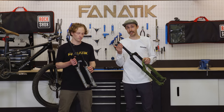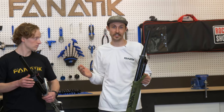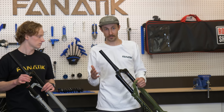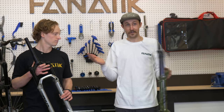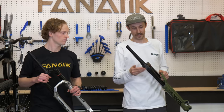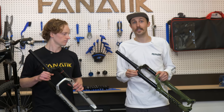This is a big deal — it makes it a lot more intuitive for riders. For example, you're running through some rollers and pumping too far into the travel, so you increase your low speed compression without messing with your high speed compression in case you front-wheel case a jump. RockShox has completely separated the high and low speed compression adjustment within this damper. There's that nice easy middle setting. This makes it super easy and intuitive to adjust your fork — you get the benefits of playing around with settings without completely losing your base setting.